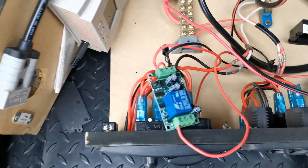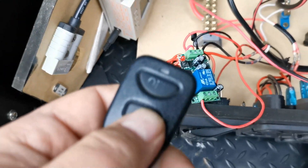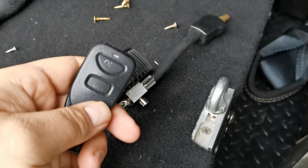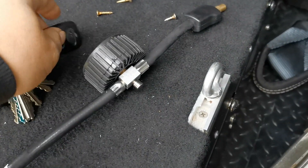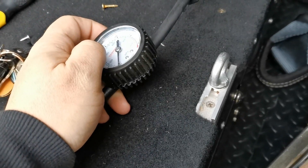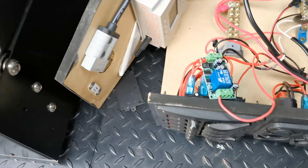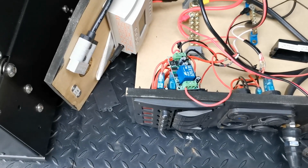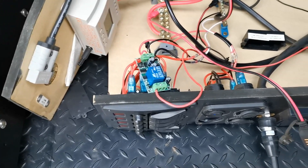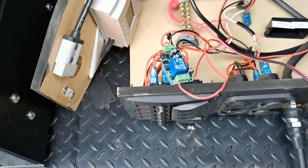Now, all you need to do is grab your remote control — mine's pretty worn and used. If you're down near the tyre, you'll screw it onto your tyre and then start pumping by hitting the button. Then if you think you're near the pressure you want, you just hit the off button and check the gauge — that'll show you a true reading. If you haven't got enough air, you just go again. That way, if you don't have two people, you can stop the compressor remotely without having to be near it and turn it off by hand.